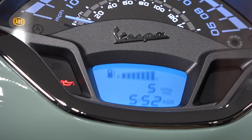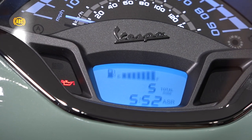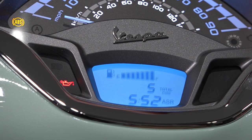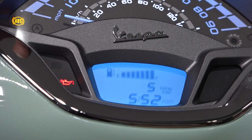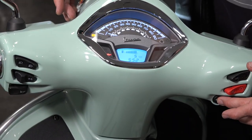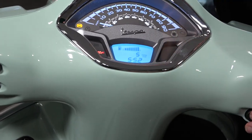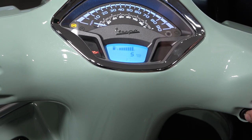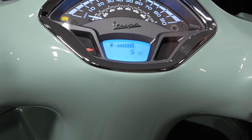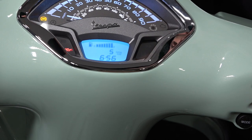When you're on the total miles indication, right below the odometer is your clock. It's a standard 12-hour clock, real easy to set. To put it in set mode — I suggest having the engine off — hold the mode button while in odometer mode. First you'll be on the hour setting. Advance to the correct hour, then hold the button again and advance the minutes. You can either let it time out and it will set the clock, or hold the mode button to set it a little quicker.